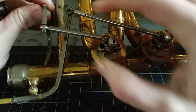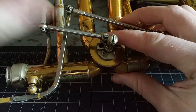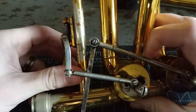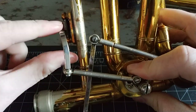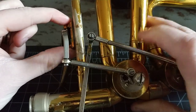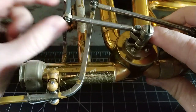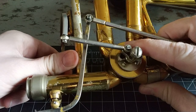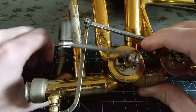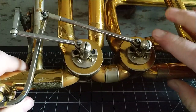If we check the ball joints by just moving them and isolating them — the ball joints are in pretty good shape, they're oiled so they're not noisy or clanky. But the saddle right here holding the trigger is completely worn out at one of the ends. You can see the movement — it moves a ton. For this, really nothing you can do about it except get a whole new trigger assembly. In this case, I just make sure it's well oiled with some nice heavy stuff, so instead of fixing the slop I treat the symptom by making sure it doesn't make a lot of noise. This paddle is just in a horrible place — that's really the biggest problem with this.